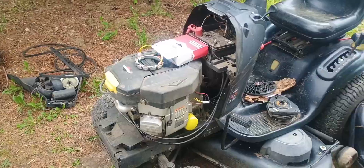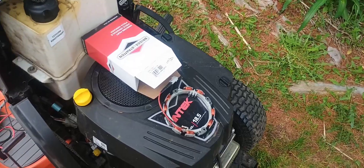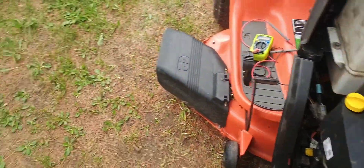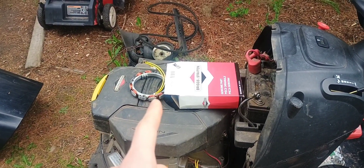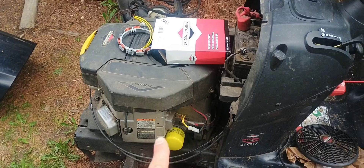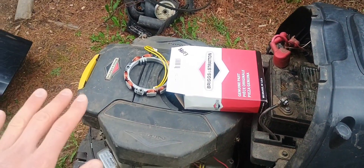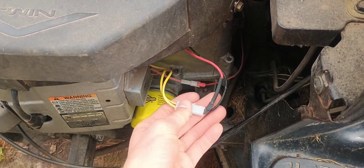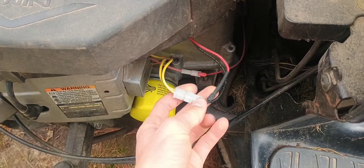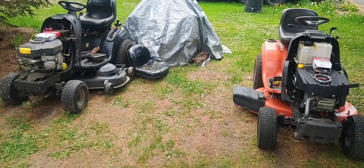There's just a bit of info on how to test these alternators. There are other things you can do like a diode test and regulator test as shown in the manual. I'm just going to be replacing the entire alternator and regulator — it's cheap enough to replace the regulator. With this mismatched alternator, it's very likely it damaged the regulator, and the battery could also be bad. I'm just going to get a whole new system. Thanks for watching.